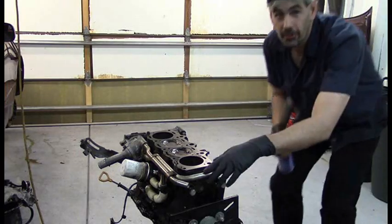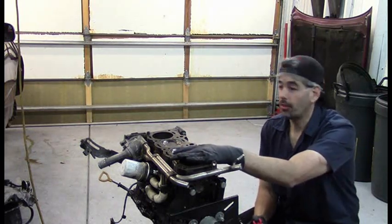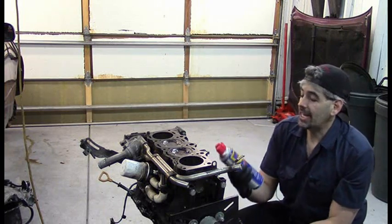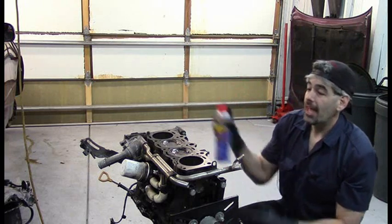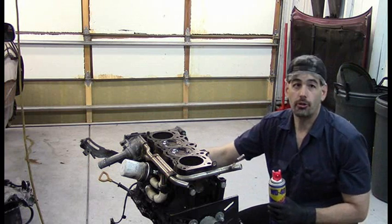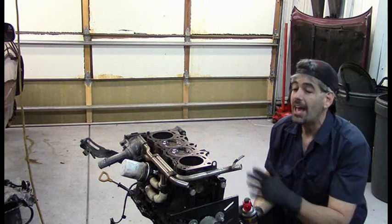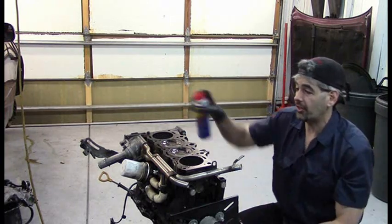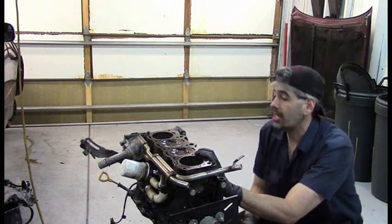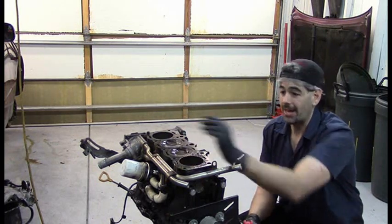One quick tip: if you aren't going to be able to finish putting the cylinder head and block together on the first day — which you almost certainly won't be if you're a beginner — I recommend using WD-40 and spraying it over the block and inside the cylinders. Make sure to also turn over the crankshaft. You just want to prevent any rusting of the surfaces, and WD-40 does a great job of that. Also cover this with a plastic bag to keep dust and anything from falling in.